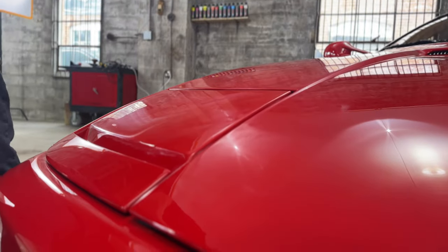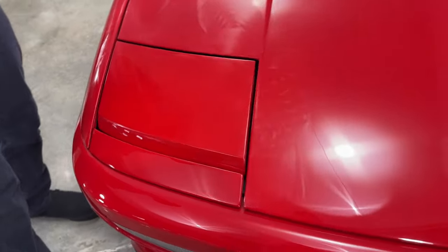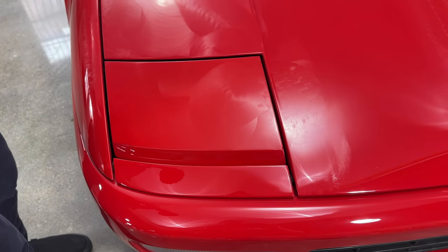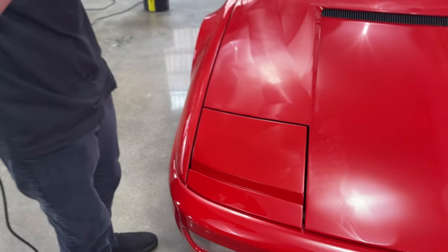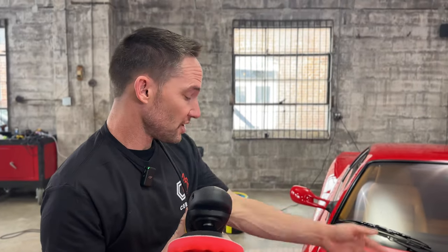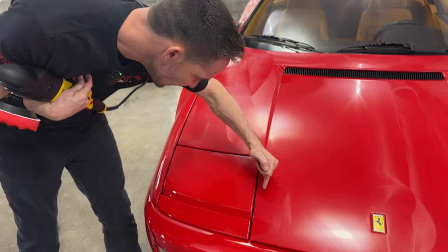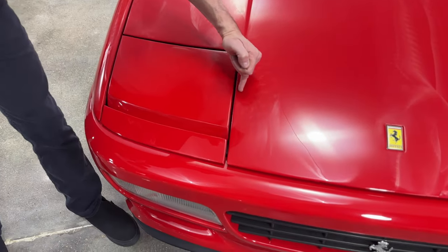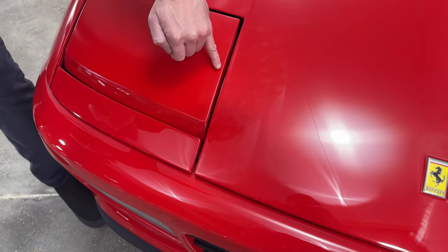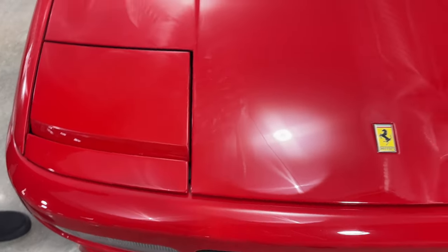And that is really key. It takes experience to know where you're polishing, and it becomes a point where you don't even think about it. But I see a lot of newbies, and myself, if I'm not paying attention, polishing in an area where I really don't want to polish. As long as the spindle's on this side of the edge, if it's far over in this area, you're basically polishing over here.